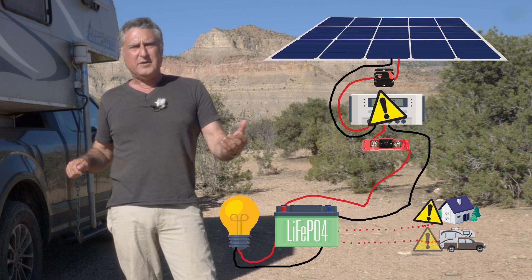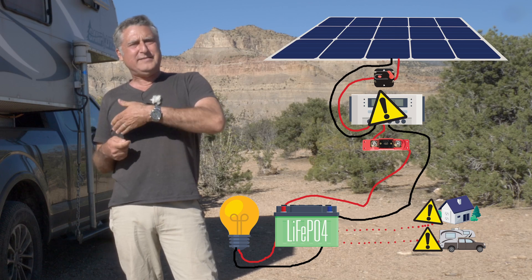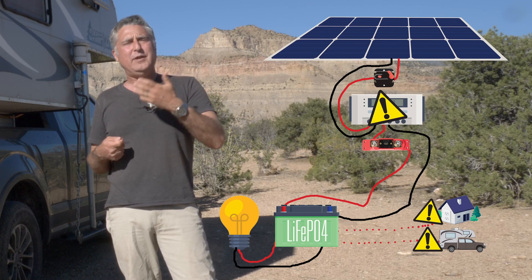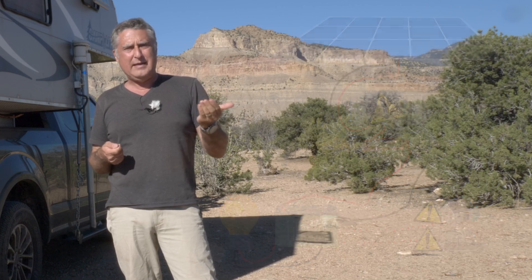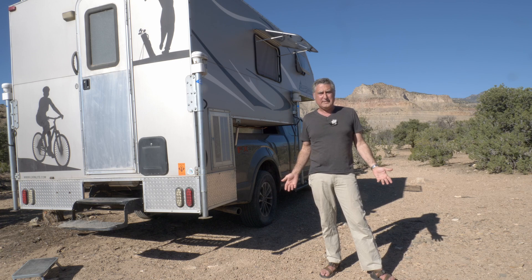Also, your vehicle charging through the trailer electrical connection, even though it doesn't put out a lot of power, once your battery gets charged it will put out too much power — it thinks you have a lead battery back there and it's going to treat your battery like lead. All of these reasons make me feel that we needed another way of doing this.